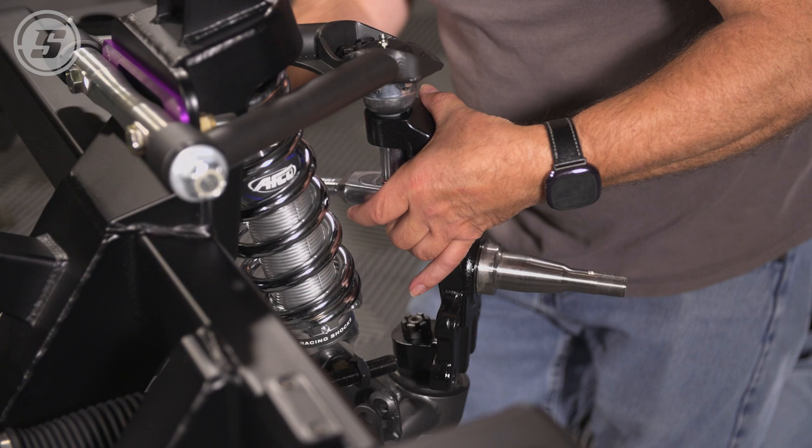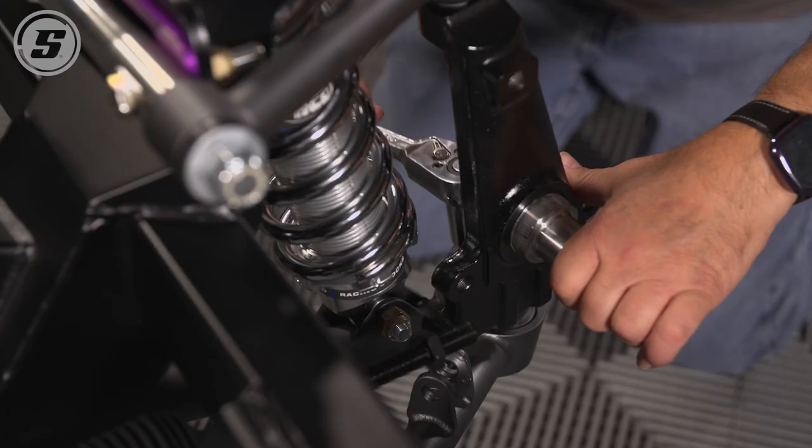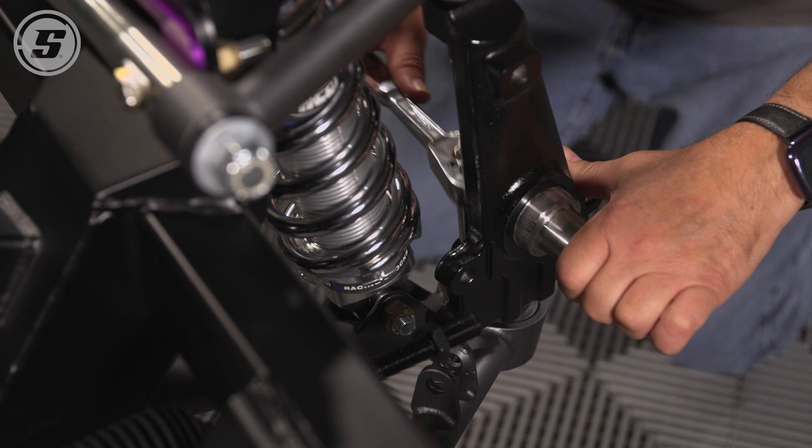And so as an assembled G-Comp suspension, we have a tall spindle and then a relatively short, compared to what might have been stock, upper control arm. And then those two things come together, add camber gain as the suspension compresses as you're going into a corner. Yeah, essentially by raising the upper ball joint, the upper arm sits at a steeper angle. So for every inch that the spindle moves up through body roll or whatnot, the upper ball joint also moves in because the arm's already angled up. So that tilts the spindle in pretty quick.